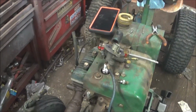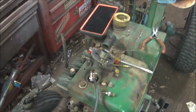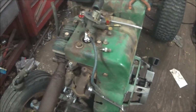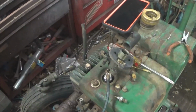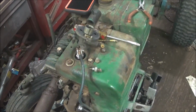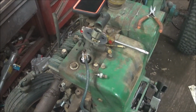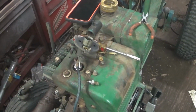I did have it popping on spray, so this engine should run. It's getting compression more I pull on it. Because, like I said, this engine was locked up. And plus, other people are going to say it, I didn't put a new head gasket on when I swapped the heads. Yes, I know that is not right. Later on, I plan on doing a head gasket to it. But this is a preliminary inspection of an engine. These older engines, you can get away with changing the head without changing the head gasket sometimes. And I didn't see any leakage, you know, because the head gaskets were made better.